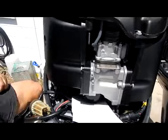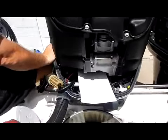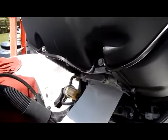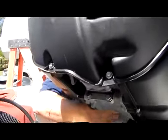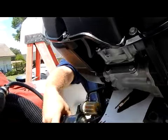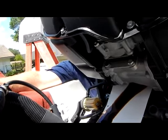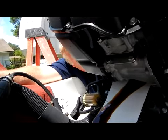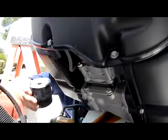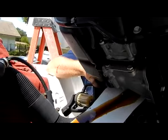Put a towel down and have a drain pan here. What we do is tilt the engine upwards, make sure that we have clearance, and once it's tilted upwards, reach in and spin that filter right off. The excess oil goes right down the cardboard ramp instead of into our engine cowling. Give that a second to drain off. Make sure you put some grease or old engine oil on the O-ring of the new filter so that it's lubricated — otherwise you run the risk of having that filter not want to come off, and then bad things happen.